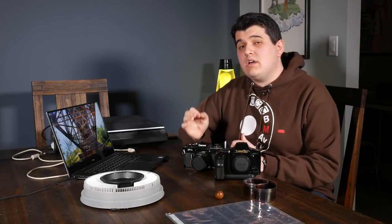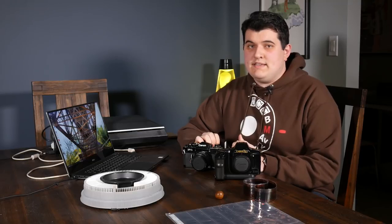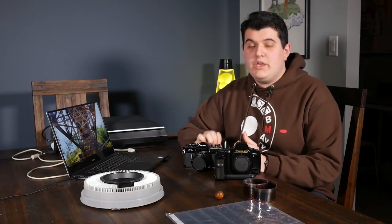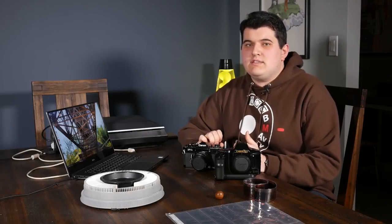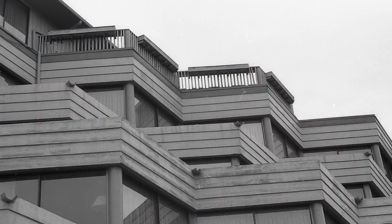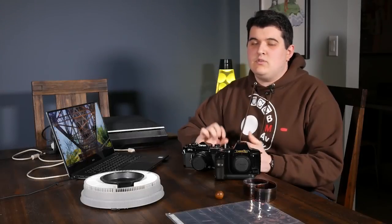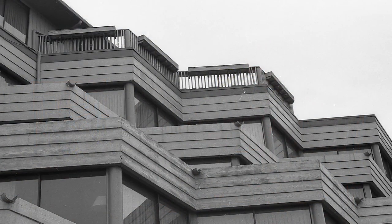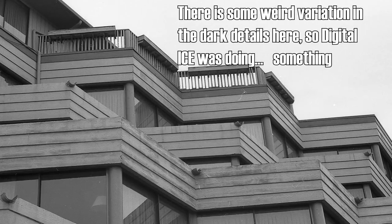It can only be used on color negative film or E6 processed slides, which includes most color slides such as Ektachrome and Fuji Velvia. Conventional black and white film doesn't work because with this film, the image is composed of silver molecules. These molecules block light from passing through it, and that's how it creates the dark areas of the film. But the silver will also block the infrared light on the second scan, so when you use Digital ICE, the scanner will see the exact same image from both passes. It's smart enough to realize there's nothing it can do and doesn't bother trying, so you just don't get any help.